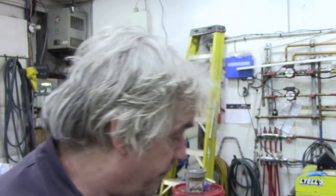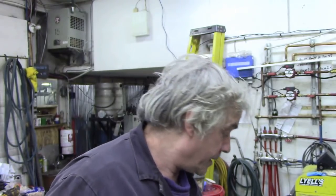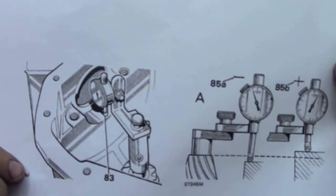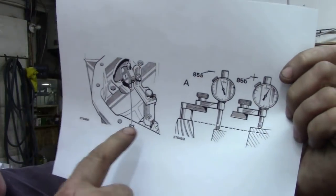That's why it's best to do it vertically, so you turn the axle so that the casing's open at the top. The mag mount was just, like I said, sticking to the end of the pinion and shifting every time you did it. So I must have done it about 20 times, and I was getting really fed up with it because I couldn't work out which was which. And what you've got to remember too, going back to this picture here, is that the pinion is not in the centre of the diff. It's to one side.